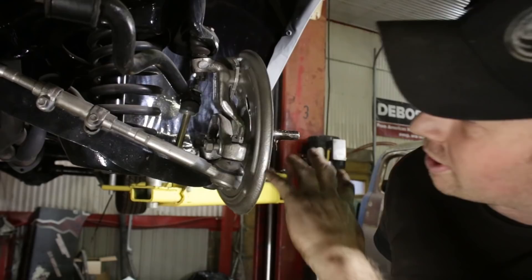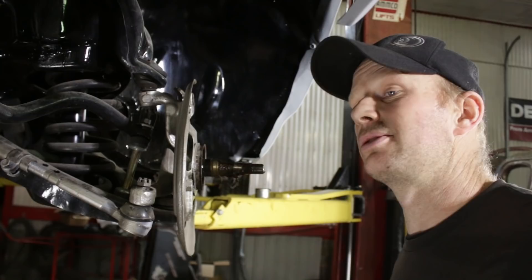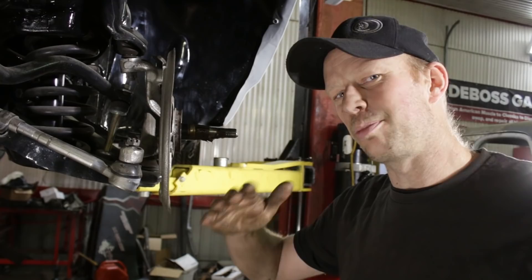These are all loose still because we've replaced everything. Before we take it on the road, we're going to take the whole car to an alignment shop. This kit also allows you to get drop spindles. We found the car — even with the engine and transmission in it — the front was up just a bit too high. So you can check out what size is appropriate for you. I think we dropped ours three-quarter inch.